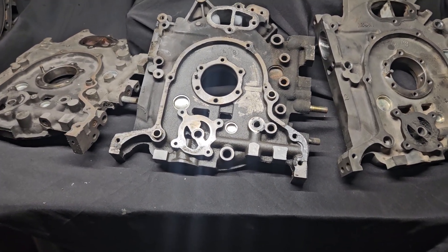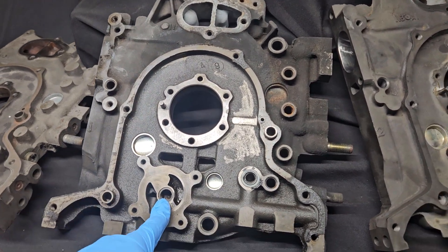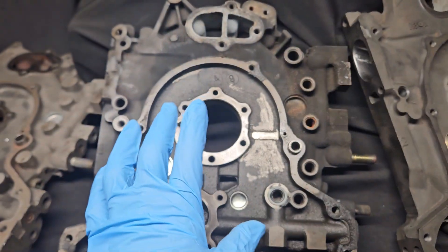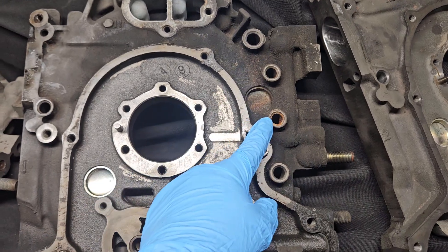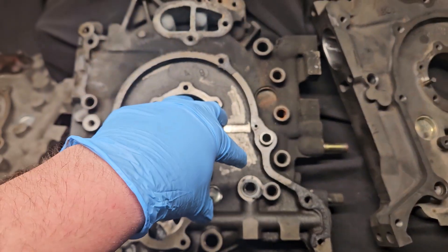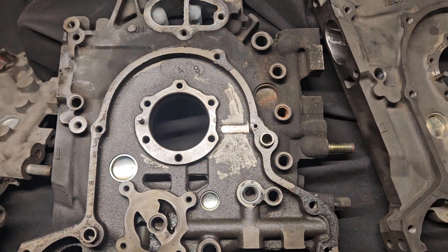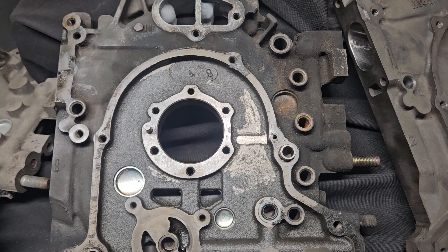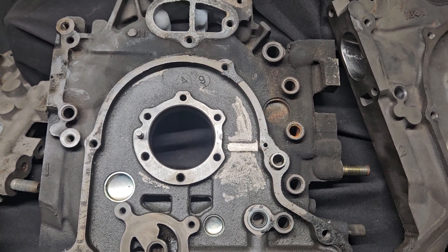We're going to take a quick look at the 20B NF01 iron and what makes it particularly unique. It all comes down to having these through holes — you've got the ability to bolt through the front iron to that thick center plate, and that allows the engines to be taken apart and assembled, because you're actually building from the thick center plate outward in both directions.